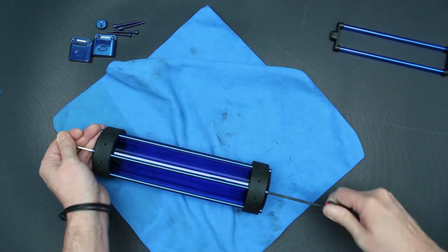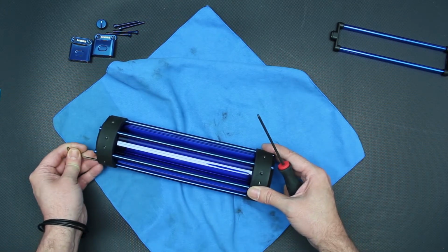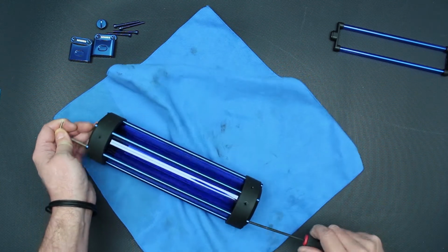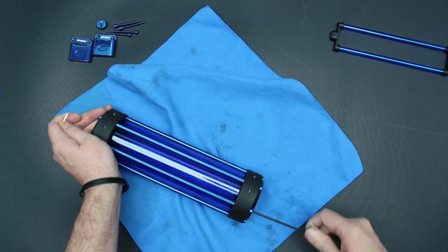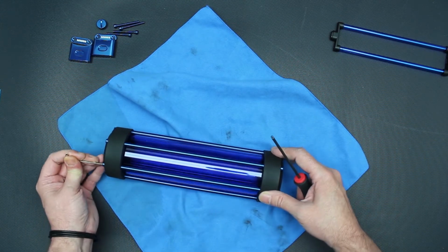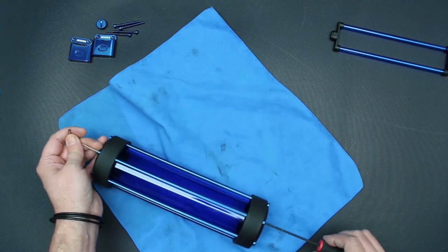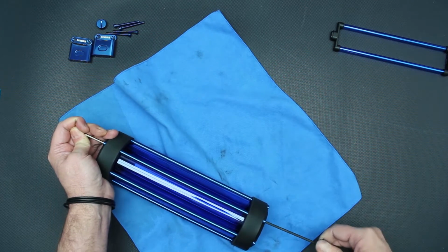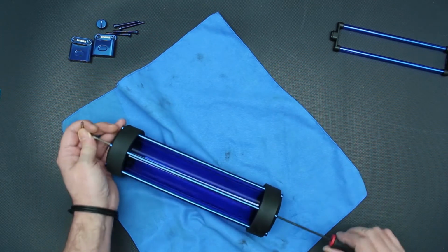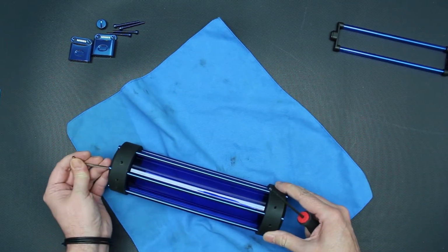It just doesn't take all that much, because our reservoirs work at less than 5 psi, which for water cooling, typically your pump's going to put out less than 5 psi. To put that in perspective, I think the human lung, if you put your lips together and puffed out your cheeks, we develop about 2 or 2.5 psi. So it's basically twice the pressure that you can make just blowing with your lungs. So it's not a super high pressure system.